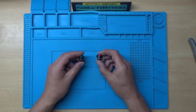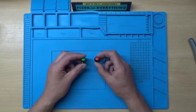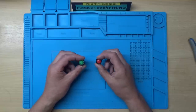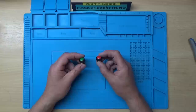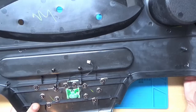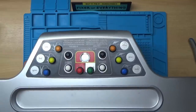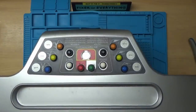I wasn't getting very far with the keypad, so I thought I'd order some buttons off Amazon - I've had a bit of a cunning plan. I'm going to drill the control panel on the treadmill and replace the keyboard with some momentary press buttons instead. I've ordered 14 of these buttons from Amazon for £9, and it was going to be £110-plus for a new membrane keyboard which would probably eventually go the same way. At least if just one button breaks I can replace just that one button. After a bit of drilling, this is what I've got - I'll flip it over - and now I need to wire it all up.